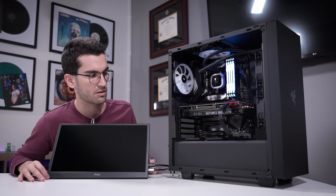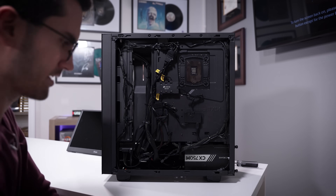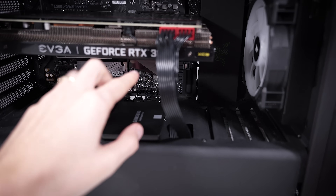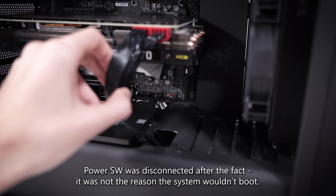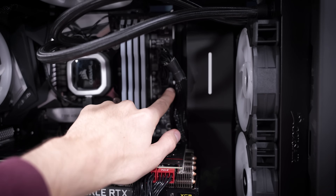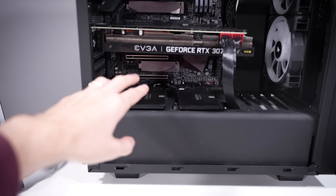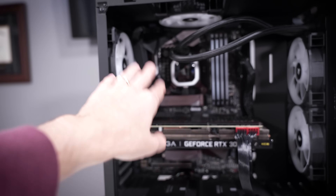This looks like it could potentially be a wiring issue. There's actually a lot of zip-tying going on here. All of his connections do look sound — I've tinkered with front IO a bit to make sure nothing was miswired. He did have polarity for his hard drive LED backwards, which I fixed, but it still wouldn't post. The 24-pin is completely connected and slotted all the way in, and same goes for the 8-pin EPS up top. So I'm going to disconnect everything non-vital: the USB cables, front IO, SATA data cables, and much of the AIO stuff behind the motherboard tray.